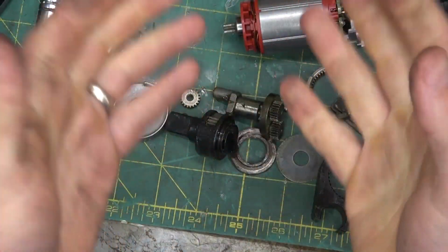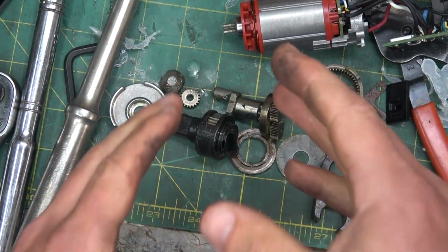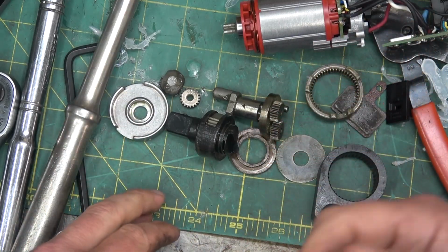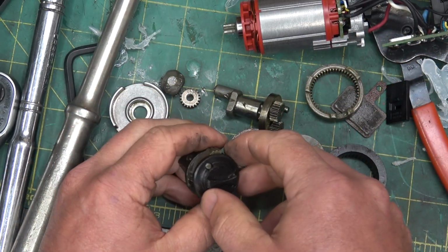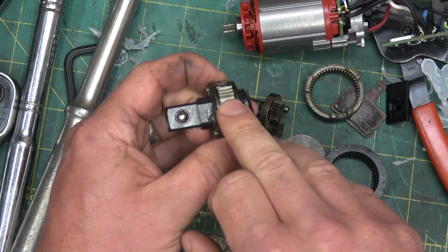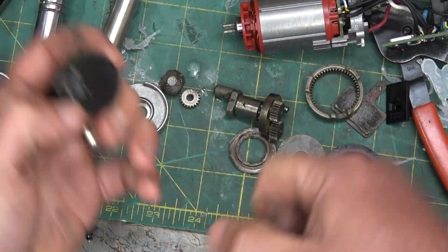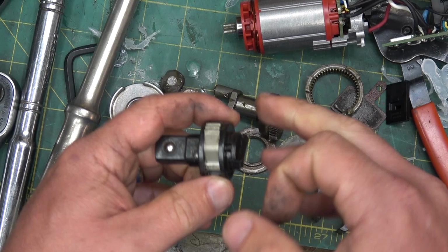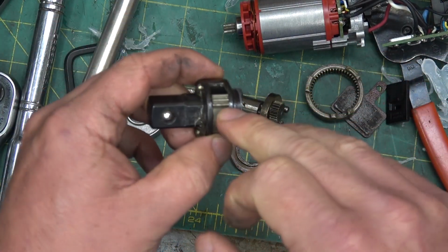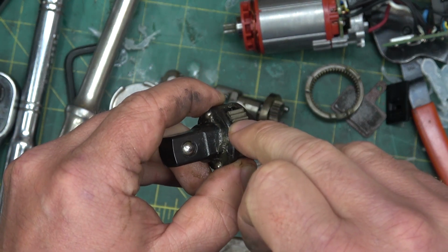But there's a fine line between super fine and too chunky, because I've been finding that with the super fine new ratchets from the Snap-ons and the Mac Tools and so forth, what happens is you chunk off one of these tiny little nubs, and this isn't tiny. This seems to be a good in-between size, so that you get a nice, decent throw, but at the same time, it's not so fine that if you just give her a bit of abuse, you end up peeling off just a tiny crest of that gear tooth.